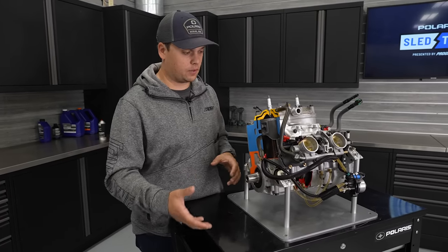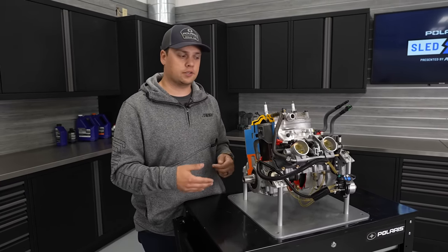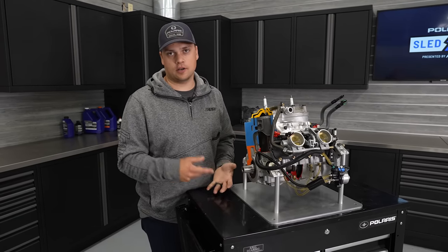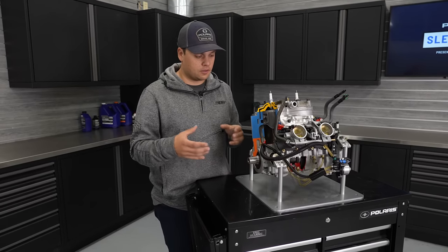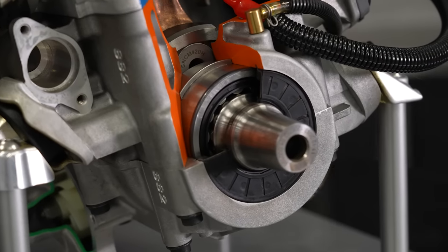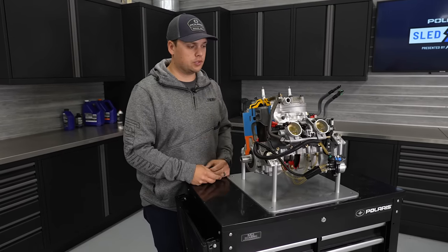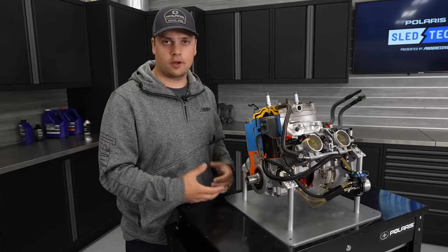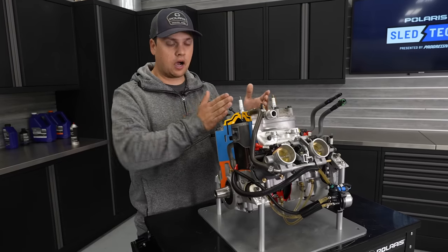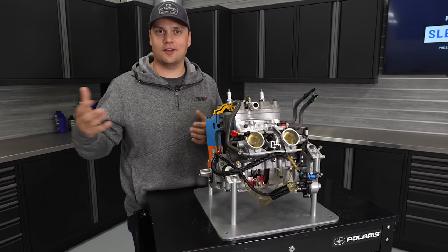When we look at the transition from the 800 HO clean fire engine to the 850 in this new platform, inertia was one of the hallmarks. The engine has 13% less inertia than the 800 HO did, and that was already a really low inertia engine. The biggest way that we did that is through the crank train — that's what's spinning. The crank is a little bit lighter than it was on the 800 HO, even though we moved the cylinders out. We knew we were going to go bigger bore at some point, so we actually moved the cylinder pitch — the distance between the centerlines of the cylinders — out by five millimeters, giving us room for bigger bore, more cooling capacity, and then 900 eventually in the future.